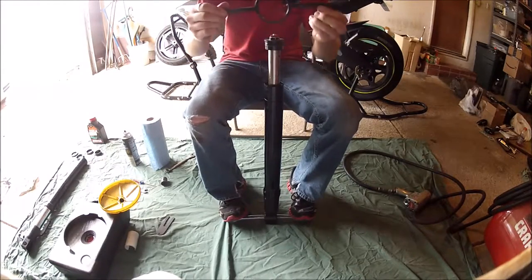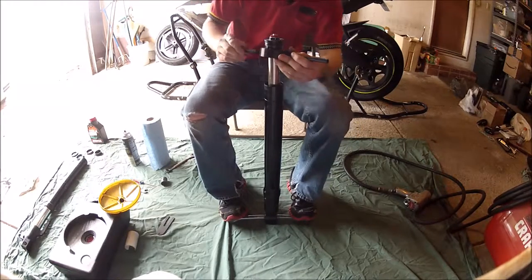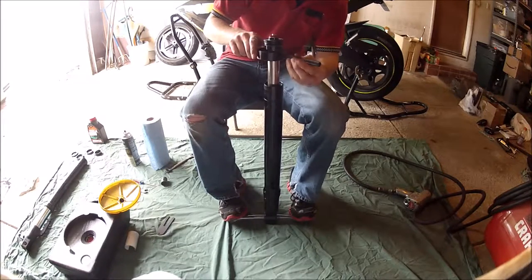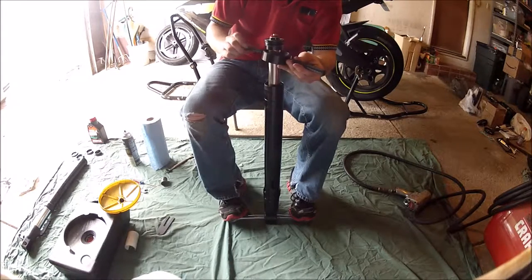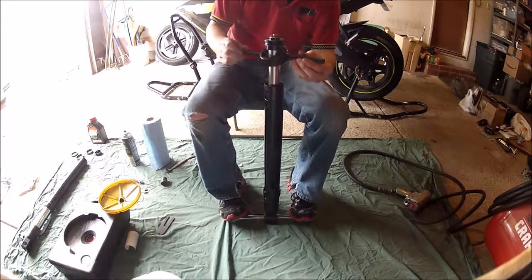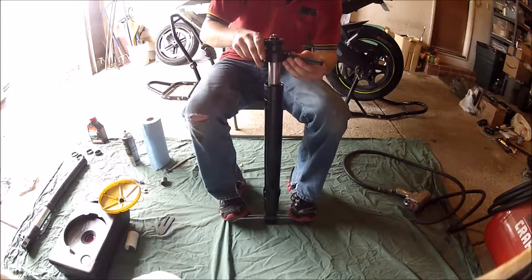You will need a special tool like this one, made by Traxion. I picked this one up for roughly 20 bucks off eBay. There are other methods to remove it, but this is the best way to do it. Other videos on YouTube show you how to use an angle channel, but that can easily slip off and you end up scoring and ruining the insert internals of your fork.